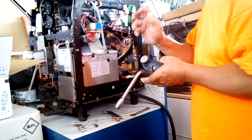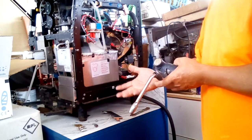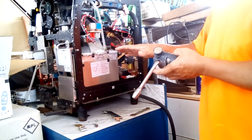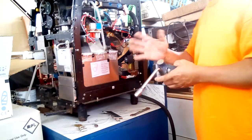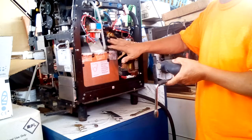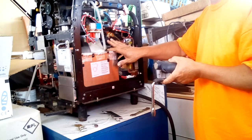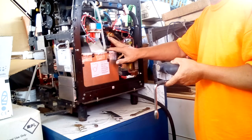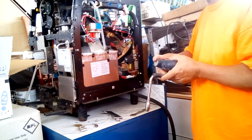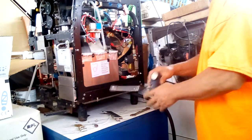Some people like that fine control, so the amount of steam that goes in, they bring the temperature of the froth milk up to a certain level, and then stop it right there. So that's for more control. So those versions would have a manual steam on. You wouldn't have the solenoid at all. They may even install, because this is not being used, they may use this as a T1 and with a manual steam one because they don't need the electronic control for the steam one.